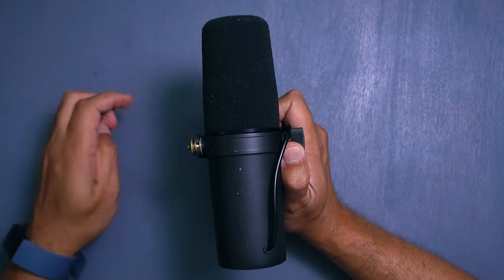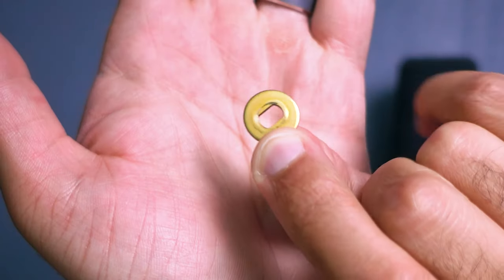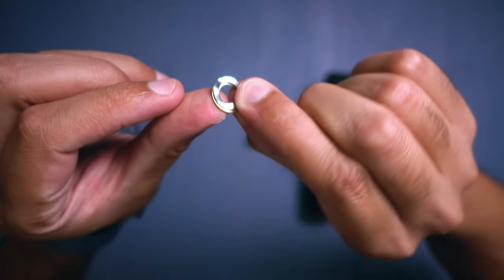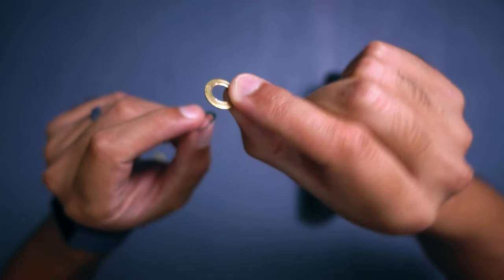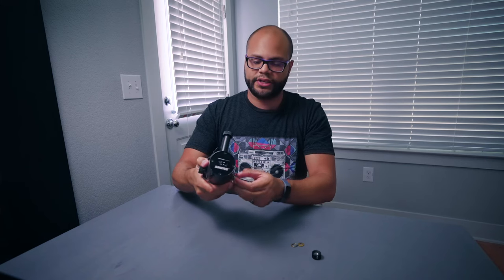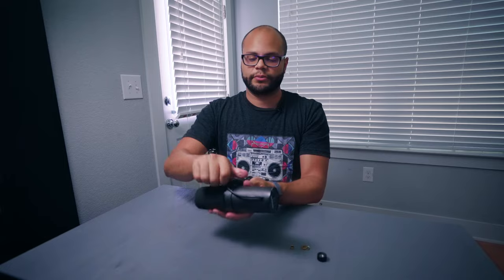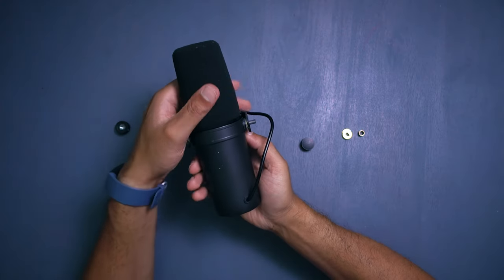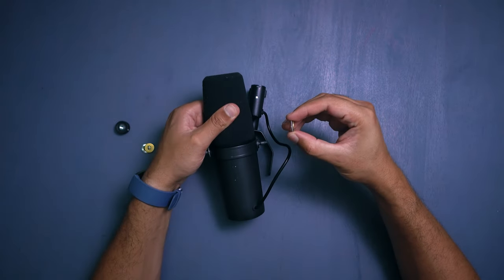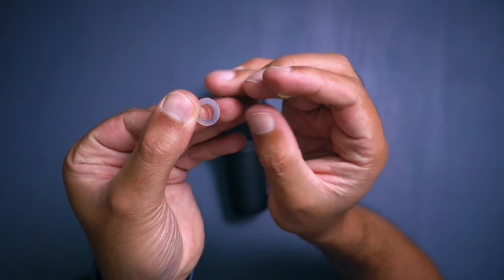To begin, loosen one end. You'll have the screw and three separate types of washers: the outermost washer is not circular on the inside — it matches the shape of the screw. The next washer is a bendy wavy kind, and below that is a standard round washer. There's also a ring around the screw that you remove — just pull on it and shake the microphone and it pops right out. With both tighteners gone, you can remove the Y bracket. There are two more washers on each side: a round washer and a plastic washer closest to the microphone.